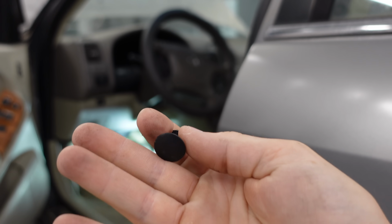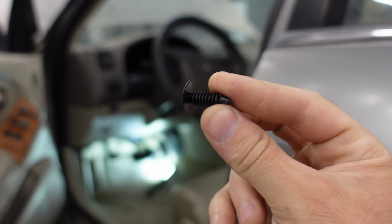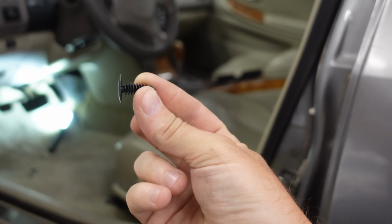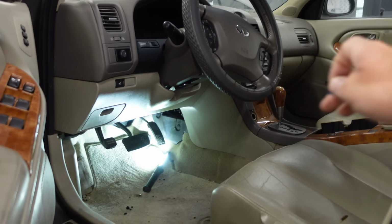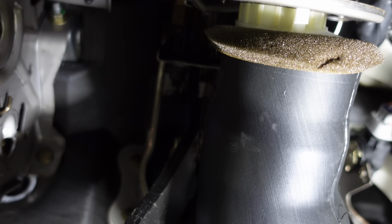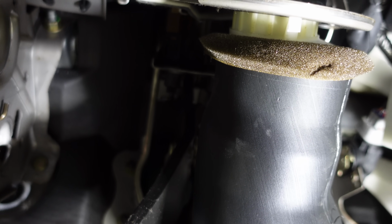Well, hopefully this is our brake light fix right here. This costs 1/10 of 1 cent because we got these from Temu. We're gonna go ahead and throw this in here and see if it fixes all of our problems. To install this, I'm just gonna push on the brake pedal, give myself a little gap, and shove this Christmas tree in.